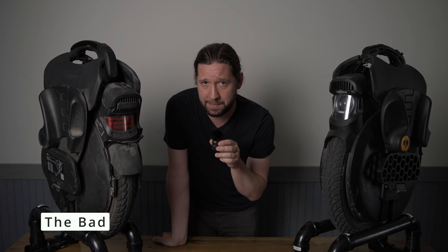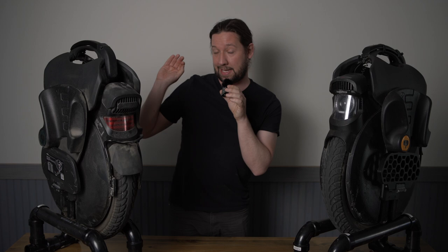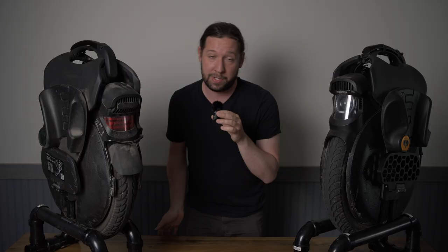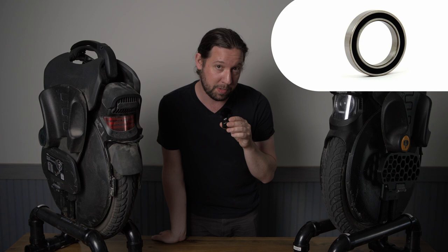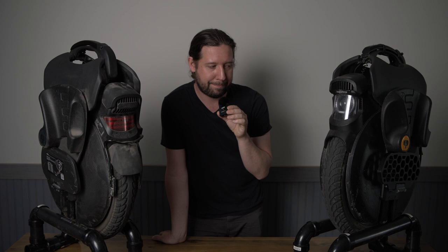Now it's time to talk about some bad things. Bearings have been plaguing the V11 since birth. They've been doing tons of updates to their bearings, and I don't know if they've fully fixed them yet. I bought one brand new and it has a thousand worry-free kilometers so far. I picked up another one used and the bearing was shot, so I tore it down to nothing and replaced it with aftermarket higher quality bearings — time will tell if those hold up better. If you're buying a V11, you may have to replace the bearings, but it's not a bad job — it's time consuming, but not very difficult.